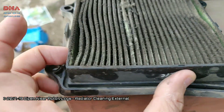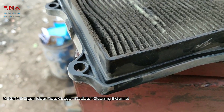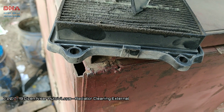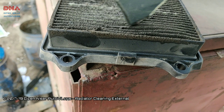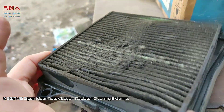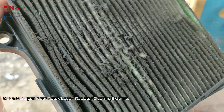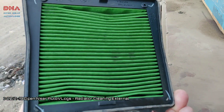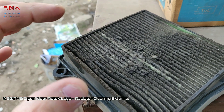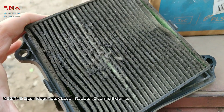This is the condition of my bike's air filter. The bike has done almost five to six thousand kilometers since the last service. You can see it is completely clogged — the green part is what I cleaned off. There's a lot of debris on it; this gets created from fog or a dusty environment, and deposits build up on the air filter. This is the intake side, where the air gets sucked in — this is what gets damaged the most. It is advisable to get the air filter checked and changed every four to five thousand kilometers.